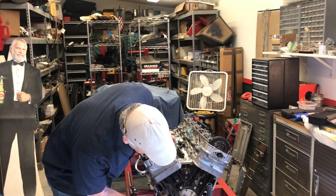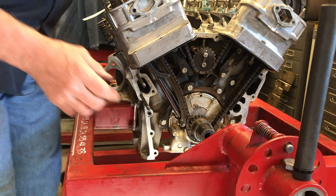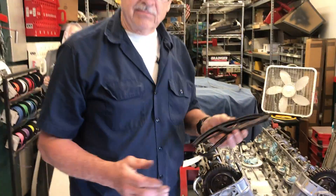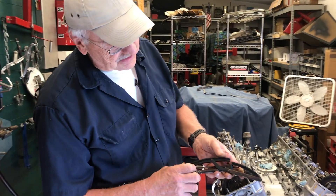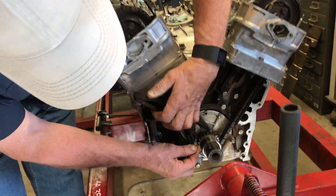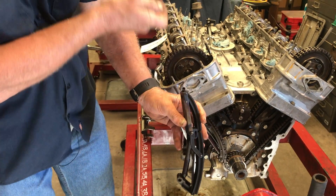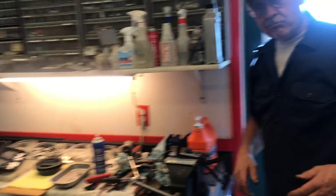This tensioner right here — its job is to provide that tension. I wish I had a good one but I don't; I've got a number of really bad ones. What these things have is a pin down here that holds the tensioner in place, and then you use a special tool to grab onto it, pull it up, and latch the mechanism. I can demonstrate that over here with another broken one.